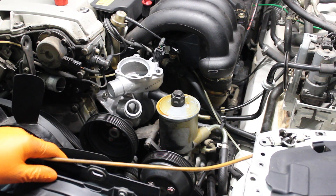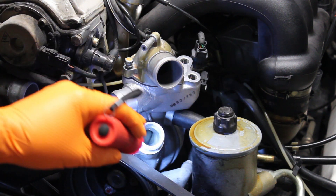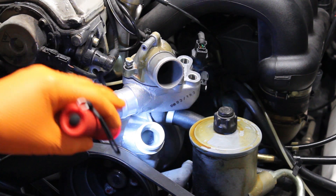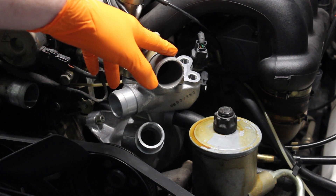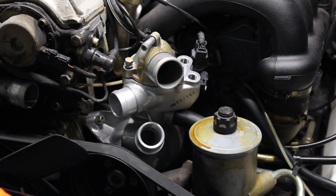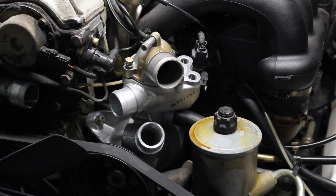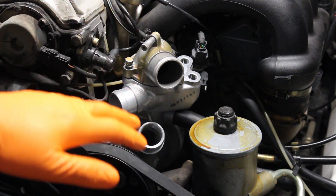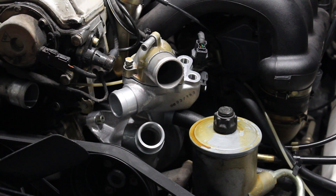We've come back after letting the new water pump sit overnight filled with water. Nothing has leaked out — the water level is still about where it was last night — so we should be good to go as far as the seals are concerned. I have the thermostat housing back on with the thermostat installed using a brand new gasket that was provided with the new water pump. All I need to do now is put the two remaining sensors in. If you're not replacing your radiator, at this point you just put everything back together, put your hoses on, and you're done. For me, since I'm replacing the radiator and all the hoses, it'll take a little bit more work.